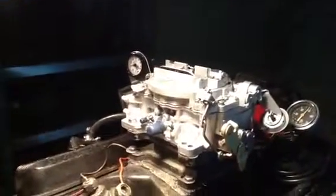Fuel pump on, electric on. Now you've got your vacuum here — there's one in the back. This is your vacuum pull-off, vacuum-adjustable secondary. You can loosen up this screw and make this as much tension as you want, so that these barrels can come in later or earlier during the process.